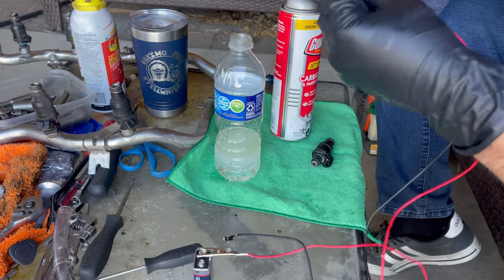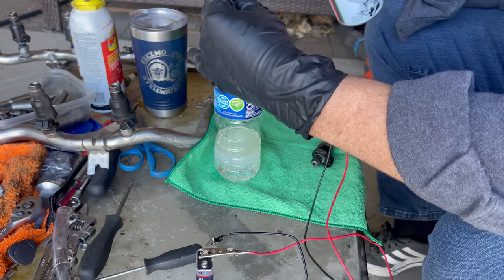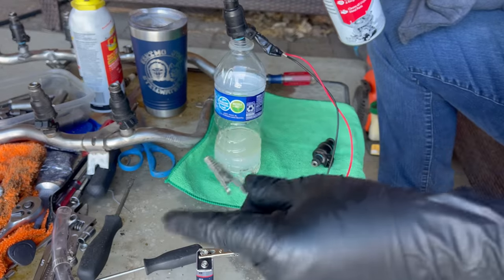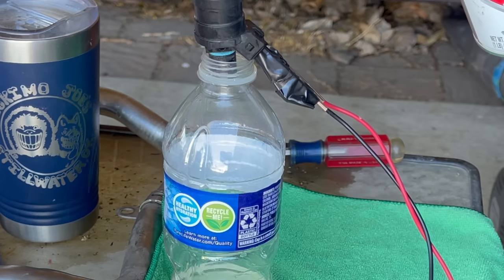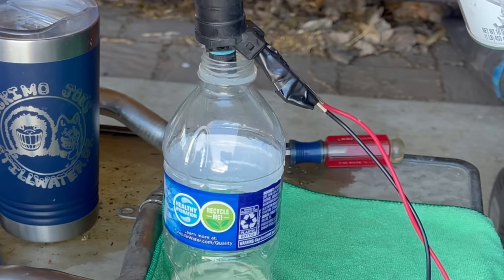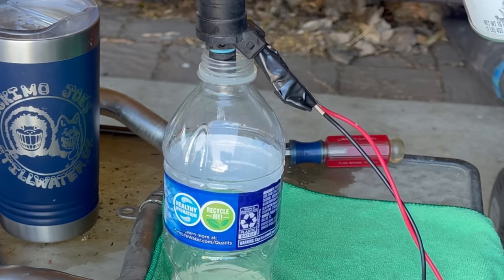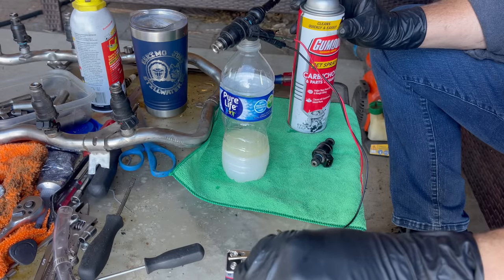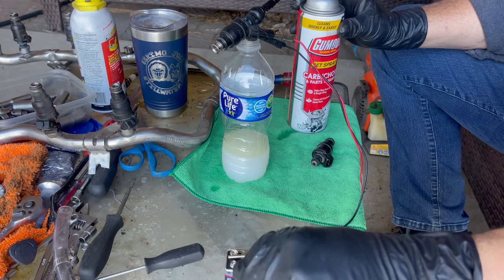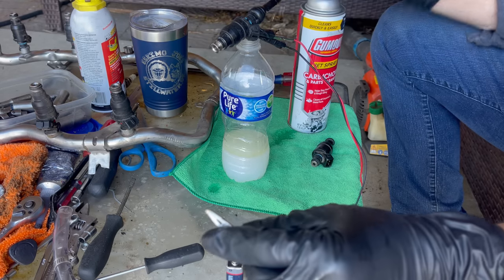Well, that's good for the fuel injector. There we go. Let's just see if it works, hopefully so. Now this isn't going to be a spray pattern because we're just cleaning out the filter, the reverse. See, it's just going to drip. There is a teeny tiny filter in there. And this is cleaning that out. And you can buy kits to rebuild these. I didn't think about that. See how much better that is? We're going to call that a win.